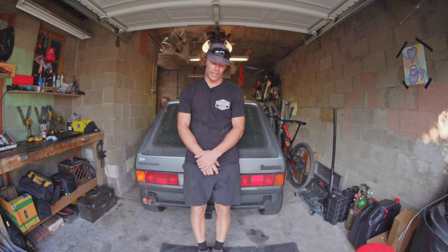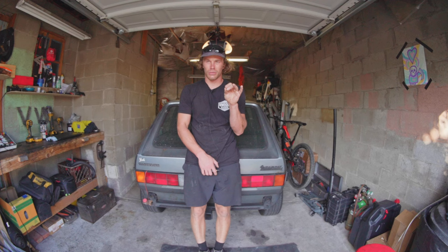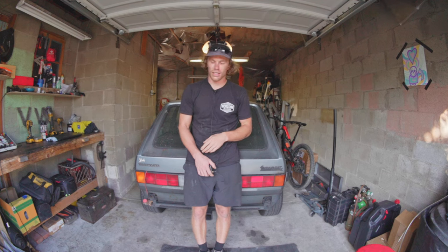That was a wildly successful test drive. My cooling system was dialed — it didn't overheat. I think I've found the crux of that problem: the cooling fans just don't come on. The fan switch mounted on the radiator must be broken or isn't getting voltage, because I was idling and we hit 210 degrees with no fan. Fortunately I have a forced fan toggle switch, so I just turned that on and it was fine. The control system worked great, the actuator's working great, the code's working great. I just need to redo the cardboard and metal for the cooling system and keep polishing things. Thanks for watching.